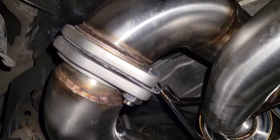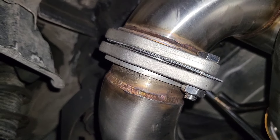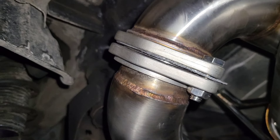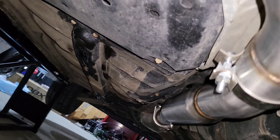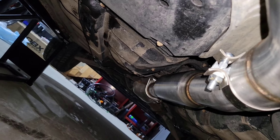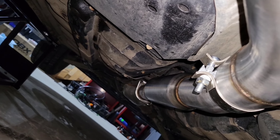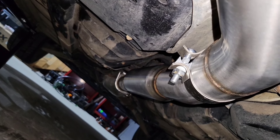I just don't get it. That flange right there makes no sense — the gasket's not even sealing, but it comes with a gasket, and that piece doesn't really even fit anywhere. And then the slip joint clamp — it's too bad, because this exhaust looks really nice. But look at the slip joint clamp — that's literally as tight as she'll go. I mean, it's probably fine, but that's literally as tight as it'll go.